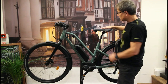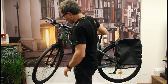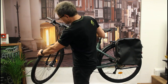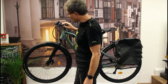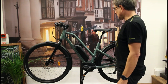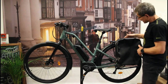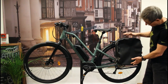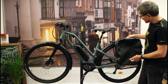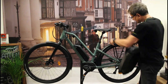There is no front suspension; however, there is a suspension seat post, so you get some comfort to absorb bumps on the road. The tires are quite wide — 700 by 42C — with a good grippy surface, and you can pump them up to 85 psi to reduce rolling resistance. The bike comes with mudguards, lights, and a rack. The rack is fitted with fittings that accommodate this bag — it's an Ortlieb bag using the QL3 system. The bag is an optional extra, but it simply clicks on and off by pulling this handle.